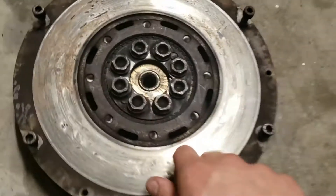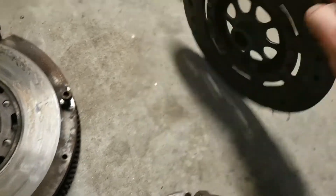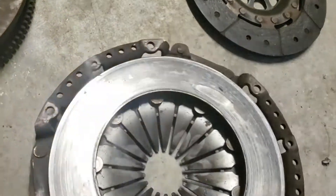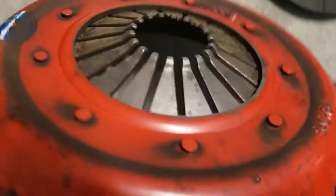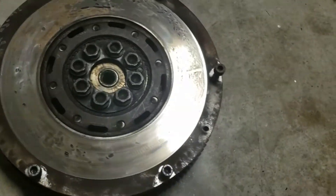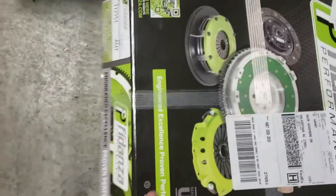Very dry around the head gasket — looking very, very good. So let's go ahead and check out this factory dual mass flywheel I had resurfaced to use with this clutch. It's a South Bend Stage 3, and you can see she got pretty hot. This one is only rated for like 425 foot-pounds, really just because it's using the dual mass flywheel. So if you want to go over 500 horsepower, just go ahead and upgrade and get that single, get that lightweight flywheel, such as this one right here.